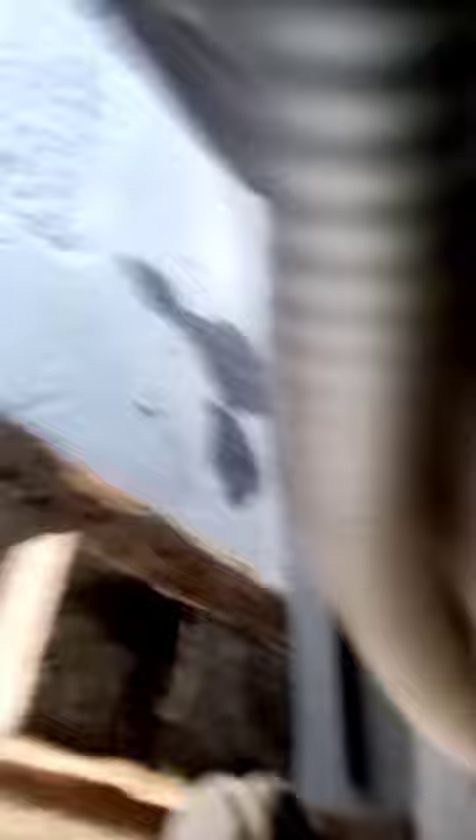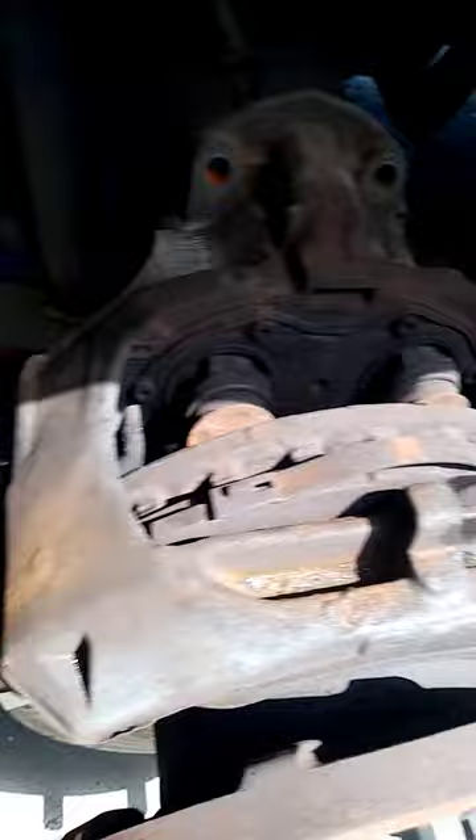What I've got to mention is these Mercs have got a weight-reduced front axle - you can see there with the holes in it. So you've just got to make sure you jack them up on the outside of that weight-reduced bit so you don't end up breaking anything.